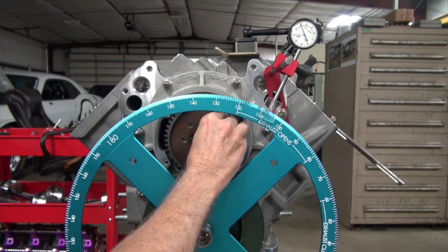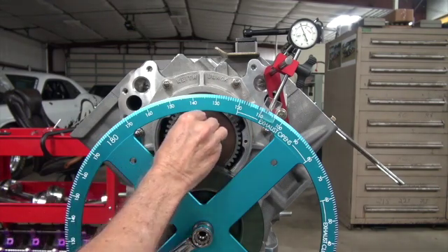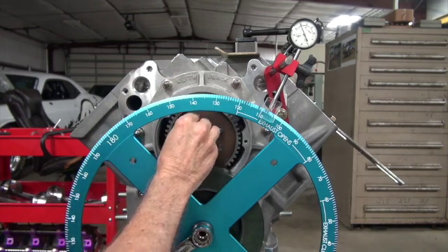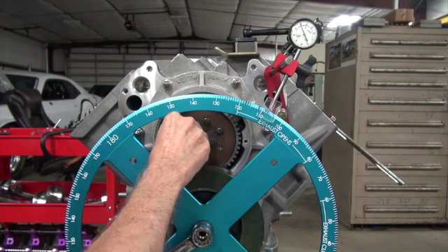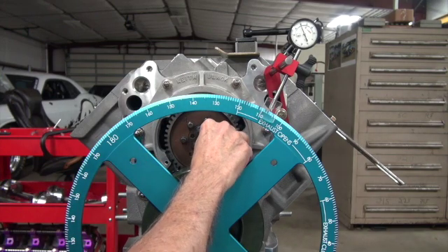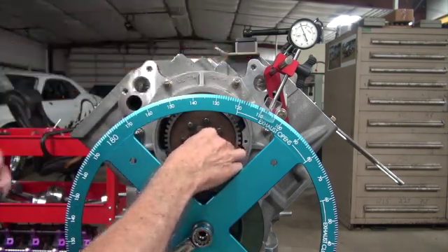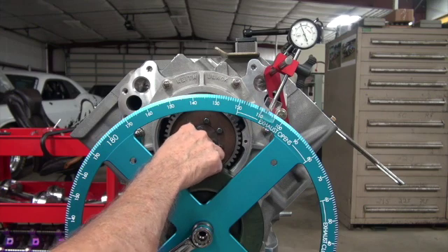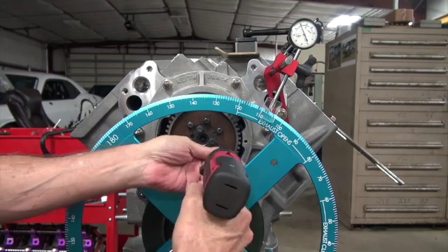What we're doing here is exactly like the simplicity of degreeing the cam to begin with — you don't do anything. You just set the crank where you want it, raise the lifter where you want it, and you've degreed it. I think people read more into this than it really is. I know it's confusing when you open the box and there's no timing marks, but I don't think it's that bad.